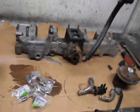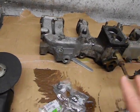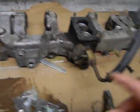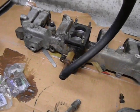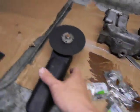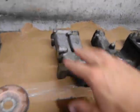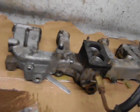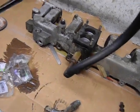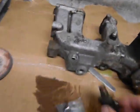This is the intake from the 1990 4.2 carbureted. It normally has coolant running through it, but I want the simplest design possible, so I'm plugging these holes. You can run coolant through it if you want, but to me colder air going in is better, and it gets rid of a lot of unnecessary plumbing. I've done it with other intakes and it works fine.